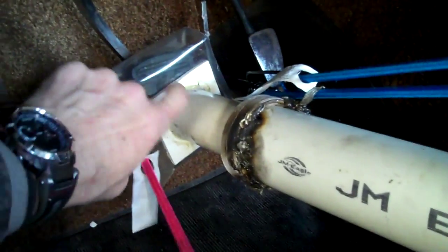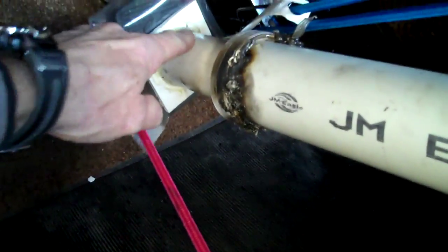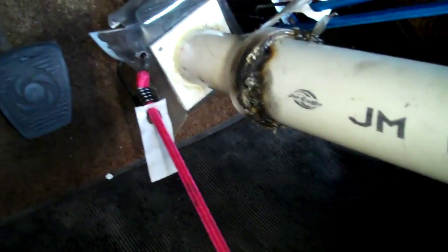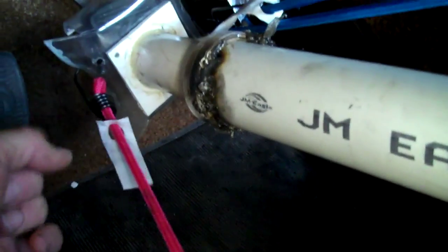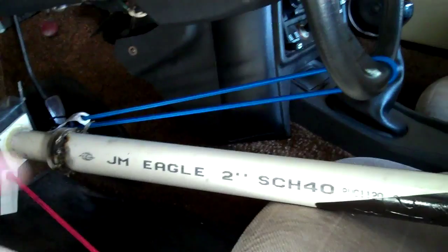Here it is finally installed in the car, ready for use. Here's the plexiglass box that surrounds the brake pedal. The top wall has the hook on the back so it'll actually hang on the brake pedal. The cylinder walls are lubed with tri-flow — miracle stuff, it'll make anything slippery. I have the bungee cords to retract the piston back after each shot. The cylinder has Gorilla Tape holding the block of wood that allows the tubing to exit with a 90-degree bend without kinking it. I have a bunch of stuff in the seat back to get the cylinder at the correct angle.